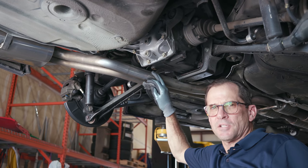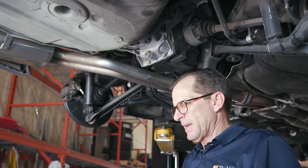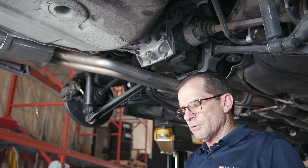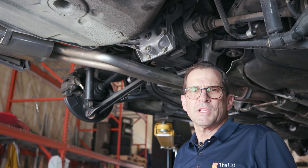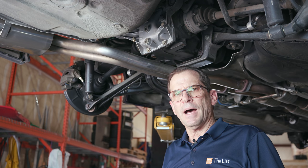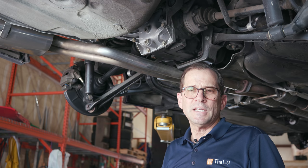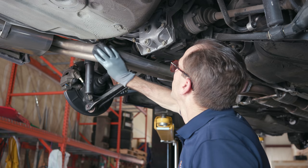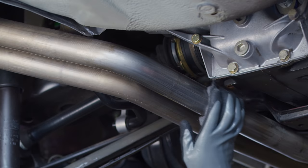When they make these stainless exhaust systems, they put them in iron mandrels and bend them. You've probably seen them, they put the pipe in there, it bends it around. Well, those dies are iron. So you might wonder, I got stainless exhaust, why is my exhaust rusting? It's because the iron is impregnated on the pipe when they bend it. And so what you're actually seeing rust is those deposits of iron. So what we're doing with this is we're removing all that rust, and you can see it comes off pretty fast.